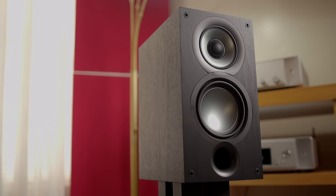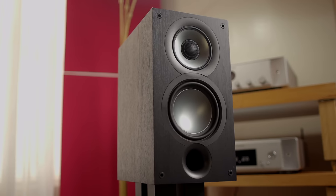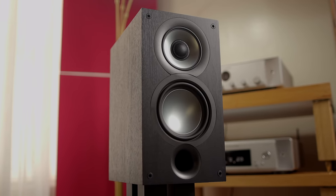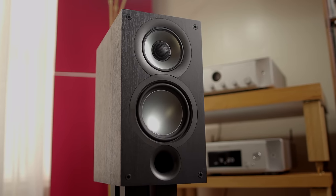The UB52 is a three-way bass reflex design featuring a one-inch soft-dome tweeter, four-inch aluminum cone mid-range, and five-and-a-quarter-inch aluminum cone woofer. On the front of the baffle, there is a dual-flared port for bass extension as low as the mid-40s in-room. The nominal impedance is six ohms and the sensitivity is rated at 85 decibels. The crossover points are 200 Hz from the woofer to the mid-range, and 2,000 Hz from the mid-range to the tweeter.